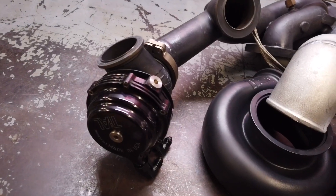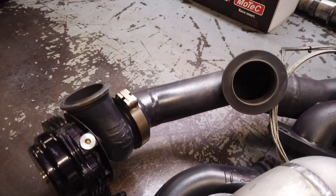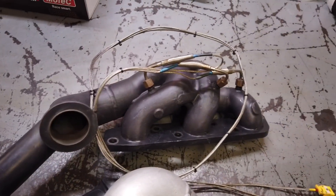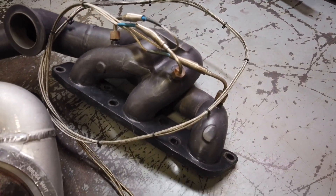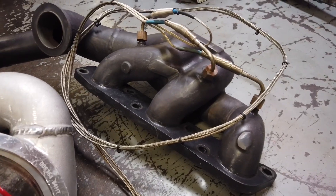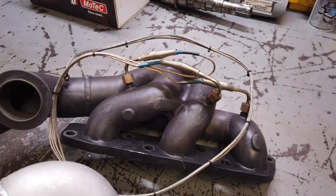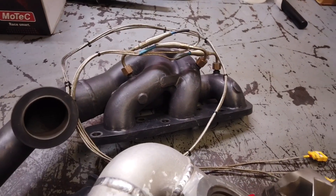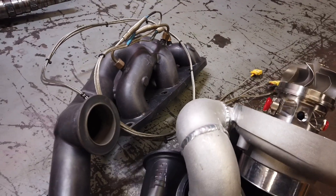We're still running the 44 millimeter gate with boost control on top and bottom with all hard AN lines, and we still have the old tried-and-tested ETS exhaust manifold. This thing originally started out as an ETS turbo kit, but this manifold is really the only thing that's left of it — everything else has been 100% customized. We port-matched the inside of the manifold and also added EGT on every single runner, which has greatly helped us improve the tune and fueling for each cylinder. It also helps us identify problems and narrow down issues to a specific cylinder with extreme accuracy because the EGT probes show everything on the log.